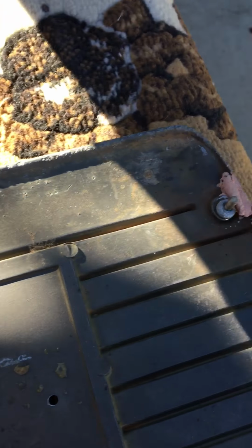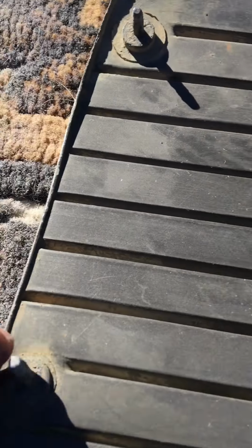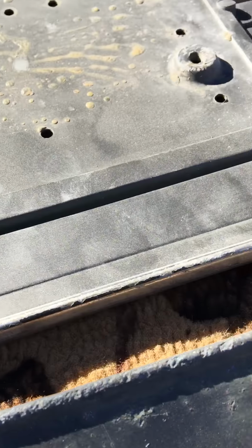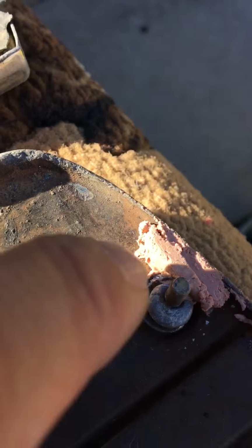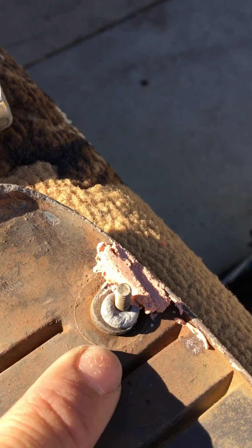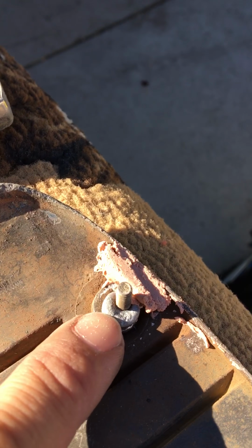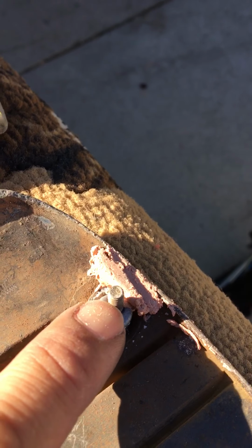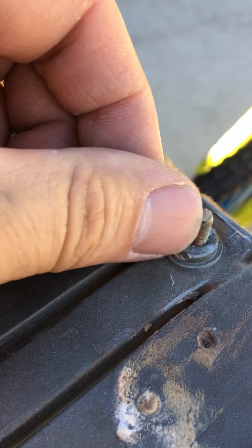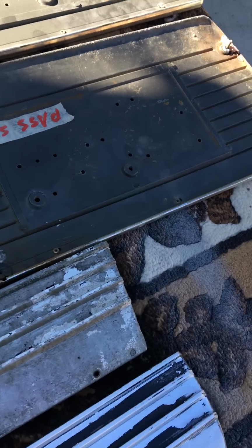You'll find that sometimes they're missing the pins. Back here, these pins could be snapped or broken off or just not operational anymore. So in that case, you really do have to figure out an alternative method. And in this case, I did use the AlumiWeld rods. I melted the whole piece itself enough, I softened it enough so that I could get a little dot of AlumiWeld in there, and then I placed that stainless steel screw in it. I'll use those to hold it in place as with the pins. But it's risky, very risky to do that job.